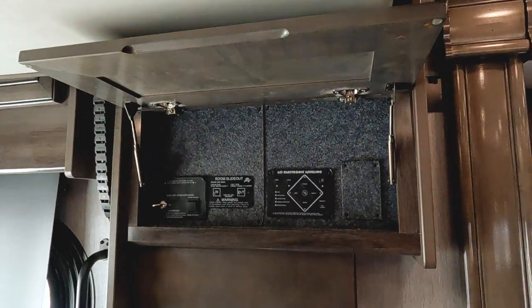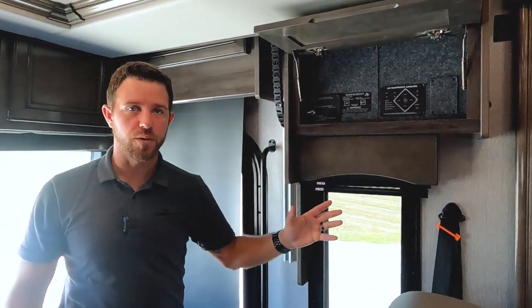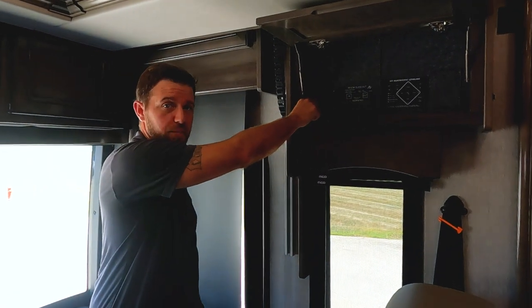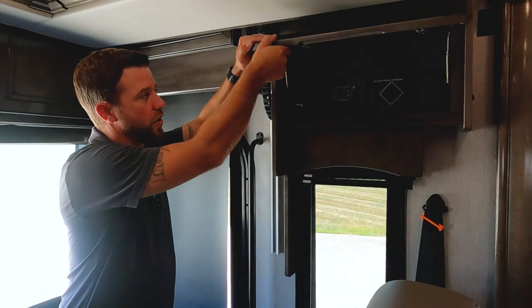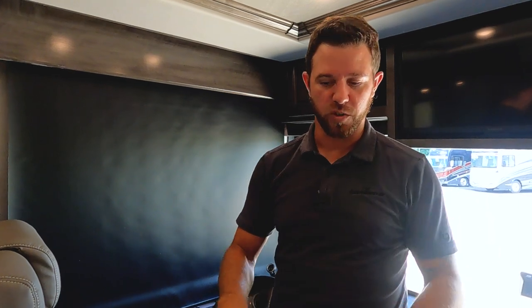Right above the passenger seat, we have another access panel and slide-out controls. We have our full slide - if the full slide is not working, first make sure this key is in the on position and that you have enough battery power. Right here is our automatic leveling system for our jacks - you can do manual or auto. On auto, make sure everybody's sitting still because if dogs are running around or kids are jumping off the top bunk, it's always calculating that weight and will never level well. Manual leveling will get you a truer, lower-to-the-ground level than auto, since auto always levels upward and never really lowers. With manual, if one side is just a little bit higher, you can drop it back down and keep it lower to the ground.